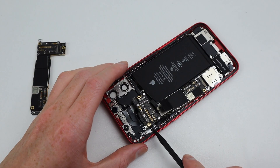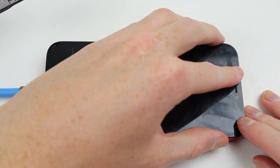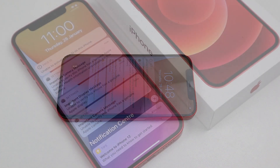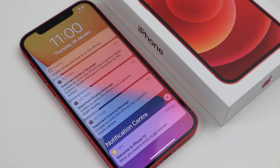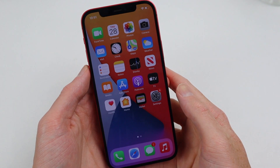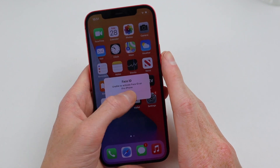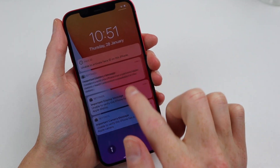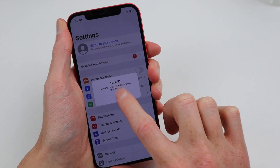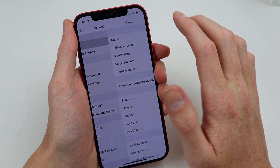I don't expect Face ID to still work, as Apple has never allowed it to be replaced in the past — just like Touch ID, they're the only ones who can program it. Upon boot we are greeted with the expected 'Face ID cannot be activated' and non-genuine display, battery, and camera messages. All of these notifications being triggered at once kept causing the phone to freeze whenever the unable-to-activate Face ID alert appeared. After unlocking the phone a few times I was eventually able to dismiss the message and touch worked perfectly fine again.